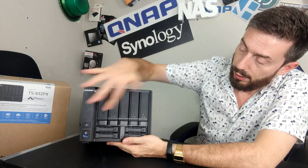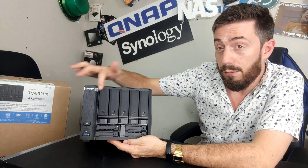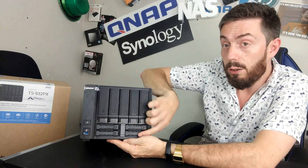On top of that, you have the five SATA bays for storage on the front, and four two-and-a-half-inch SSD SATA bays at the bottom. SSDs in desktop NAS is not a new thing — a lot of companies have been doing it for caching, and QNAP are doing it as well with their auto-caching system. But you can utilize them for raw storage. You could populate this device with hard drives, use two SSDs for caching and improving performance, and two SSDs for raw storage.